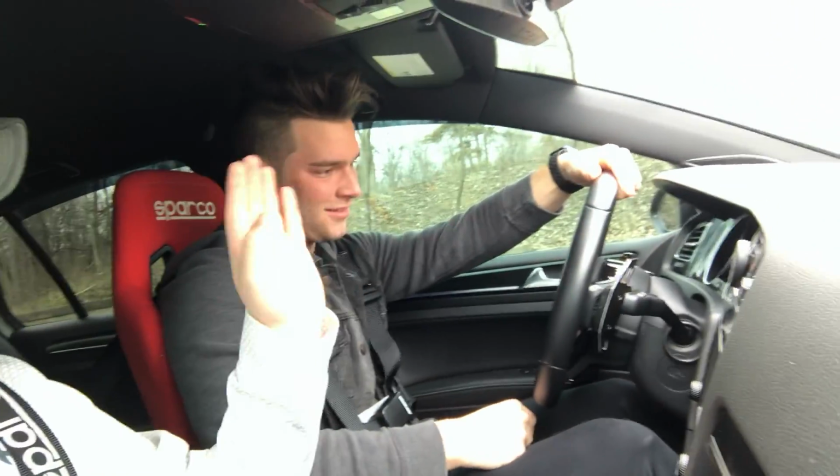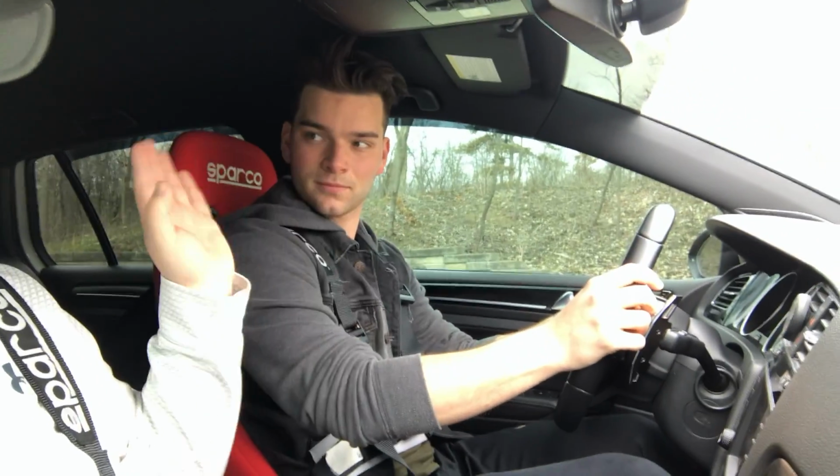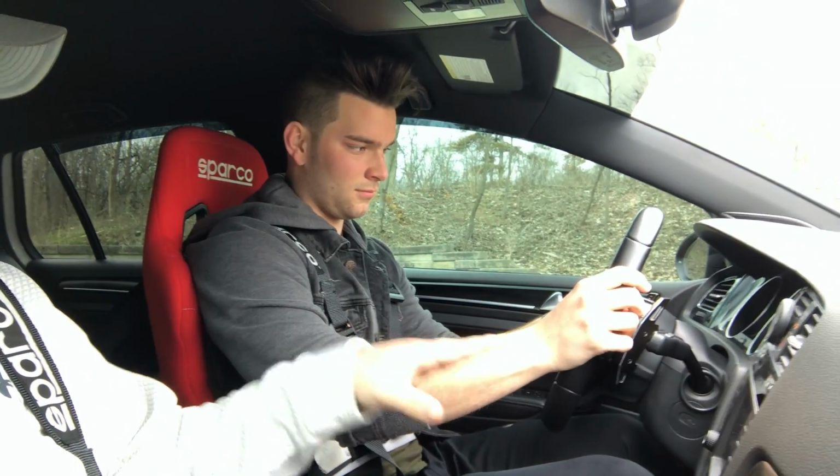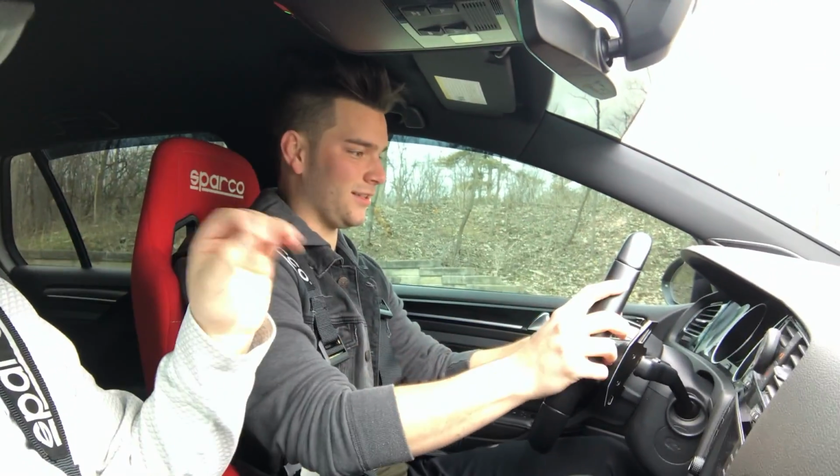Oh my god. Now if you floor it, it'll do 35, but try it again, and floor it past flooring it. You'll feel a little overdrive, it's called kickdown. So if I'm cruising in S5, sport gear, and I just mash the pedal past that little button, it shifts to the lowest possible gear it can just to get ready to go. I don't know how to explain it. You'll feel it. What are you talking about? Floor it now, but not hard, and then press it down harder. Push it harder than that. Oh, yeah, okay, that little extra space.